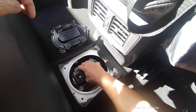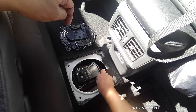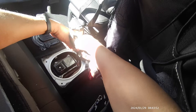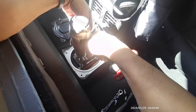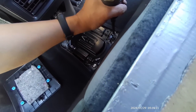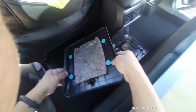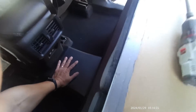Put it back — you can't really mistake it; it's got guides so you don't strip the bolts. Put it on there — you don't have to torque it down. I've got it set on 14, which is enough; actually I'll put it on 12. Again, it doesn't have to be heavily torqued down. Put the cover back on as well. Use the offset wrench on this piece right here, get the clips on — narrow side to the front — just like that, put it down.